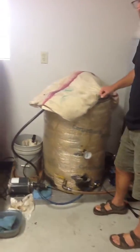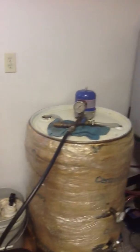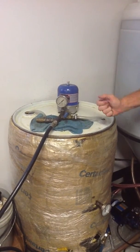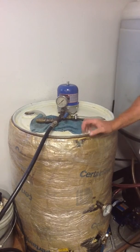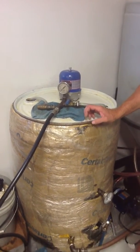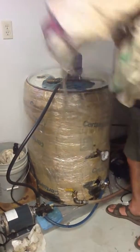Right here is my unit. I run a 120-gallon-per-hour unit on a 55-gallon drum. I can clean the oil and I can dry the oil. This is not complicated, people — seriously. There's a little bit of a learning curve when you start, probably two or three drums' worth. After that, this is simple.